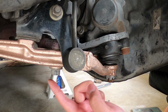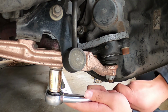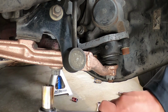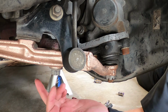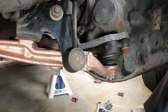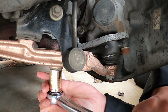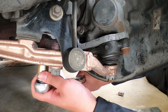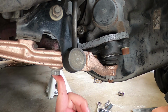Next common thing is this bolt right here. This needs to be tightened a lot. Like I want to say it's like 190 foot-pounds, but I'll just give it a few ugga-duggas and see if it's tight. So let's see, are these two tight? These are the two bolts that connect the lower control arm to the caster arm to the chassis. So let's just get it down, check for tight. Oh yeah, that's not moving. Let's see this. Yep, it's tight. These two are tight.